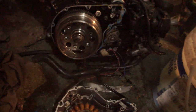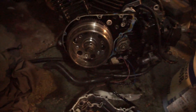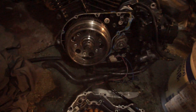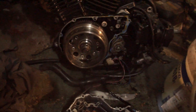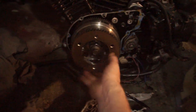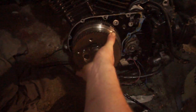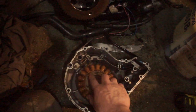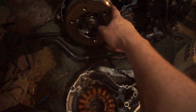But at work yesterday, we had a 2012 Jeep Patriot engine that was locked up, spun some bearings, so I pulled its crank trigger off, and everything is stopped. Fits pretty good. It's big enough that it would hit the original crank sensor here, and I'd probably have to trim some of the side cover casing here, maybe this bracket that holds the stator winding wires in place. But this might be a good starting point.